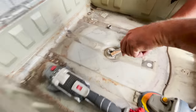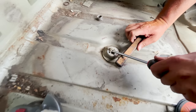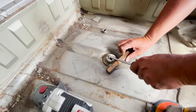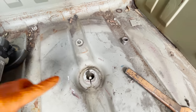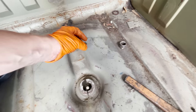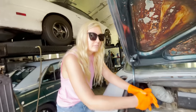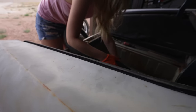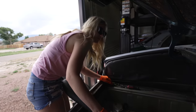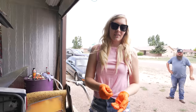Ended up cutting the full piece off - now we're just left with this little piece here. That's it - this is what causes cars to take so long. Oh, just set the fuel cell in there - nope, we're gonna spend an hour trying to get the little nub off. So there it is, got it opened up, got that out. We'll just sand this flat and it'll sit back over it. That little sleeve right there is what was fighting us - they must drop that in from the other side and weld it in.